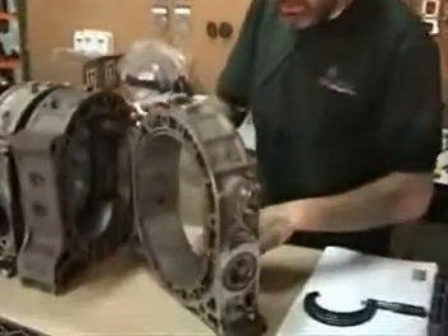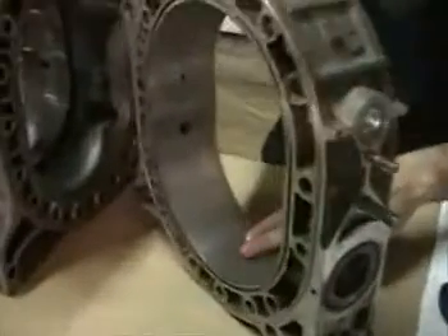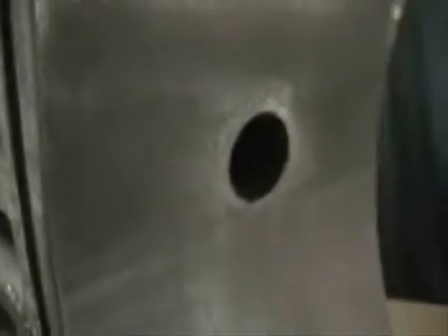This is another example — a unique one. This rotor housing comes out of a 12A motor that was downshifted from fifth gear down into second. Because of the light rotors it almost instantly spun up and buried the tach, vaporizing the apex seals in the motor. You'll see the crosshatch scratching from the apex seals. This similar crosshatch pattern will also exist on a motor that's been run without an air cleaner. A light bit of scratch is okay, but any scratching on the surface means you're getting a little bit of leakage and inefficiency.